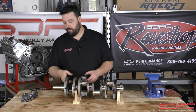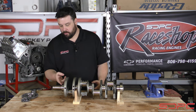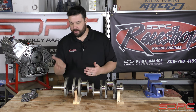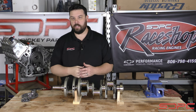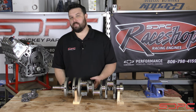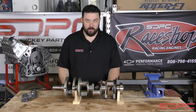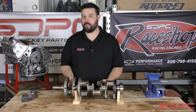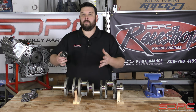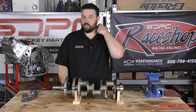If you ever look at the journals on a crankshaft, whether aftermarket or OEM, they have a little chamfer on them. It isn't a perfect 90-degree cut like the edge of a box — it actually has a nice little curve on that cut. It adds strength and it's easier to machine, but the problem is that sometimes when you put these parts together you have to make sure to get special parts. You have to get narrowed bearings for some of these aftermarket cranks because of that chamfer. If you run a full-width OEM-style bearing, you can actually burn the edges off of it and cause a lot of trouble.